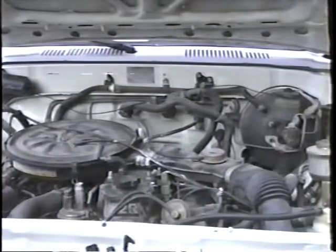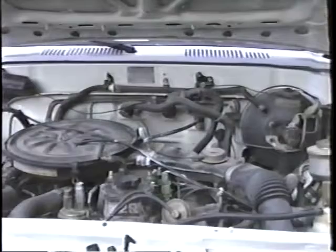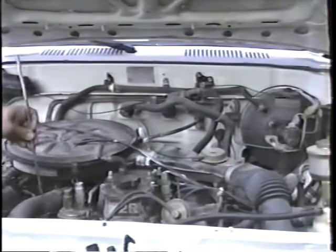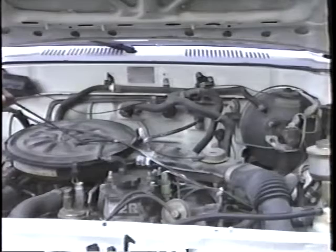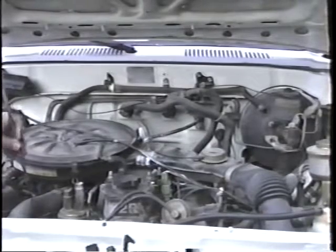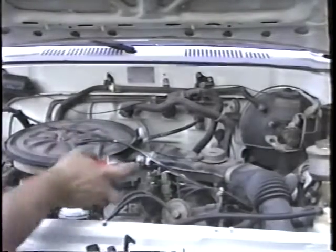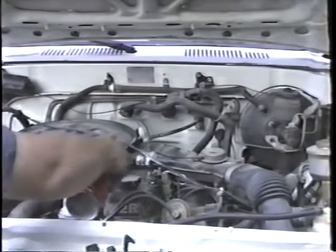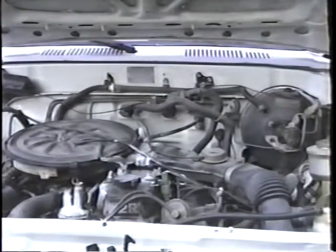Make sure to look down around the bottom of the motor to see if there's any kind of grease. Spray down there real good, get all the grease and oil off. Don't spray any on the painted areas either, because it will take the paint off. Spray it just on the dirty, greasy areas on the engine block. It doesn't take a whole lot to cover it to do the job. Make sure not to get it on any paint on the fenders or any paint on the vehicle.